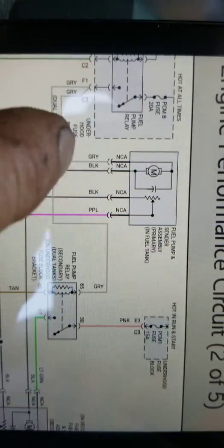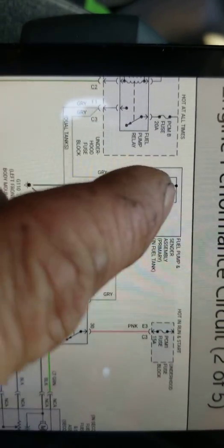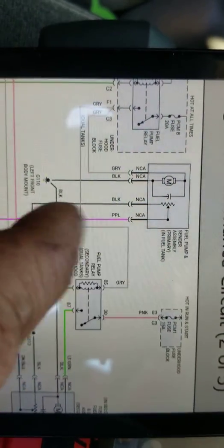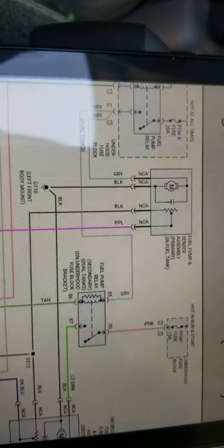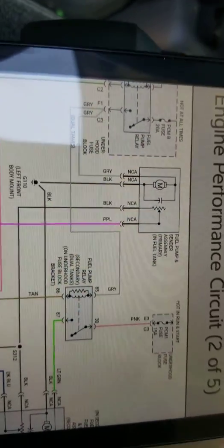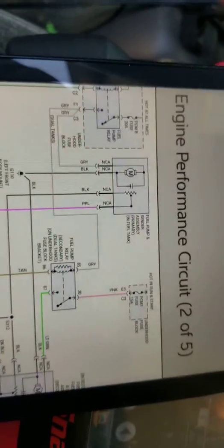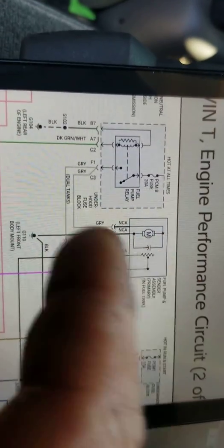So this is our fuel pump. You can see that it gets its power feed. Right here is its ground, right? And then this is our sending assembly, all right? Now, I have suspicions that the sending unit in this is bad or faulty. Imagine that. Because the guy was like, well, I know I had 1/8 of a tank in there, and I went under there and tapped on the tank, and it sounds empty, right? Nevertheless, the gauge was reading that it had fuel in it. And we all know how them sender units fail.